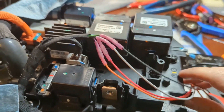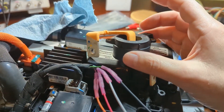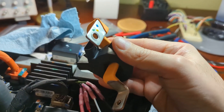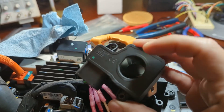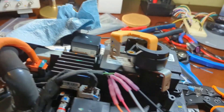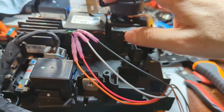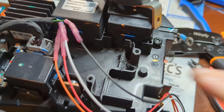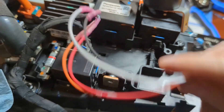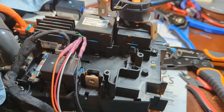I just got through getting these wires extended to this new plug. What I'm trying to do is use this new current sensor, which I think is the S124, to replace the one that comes on the Chevy Volt. Unfortunately the VCU I'm using doesn't support that original current sensor, but it does support the S124. I took it and made it fit - luckily the bolt holes are the same but some of the plastic is not quite right, so I had to dremel out a few things. This has a different plug so I'll get these wires routed and tucked away for the new current sensor.